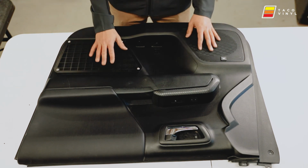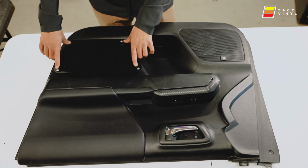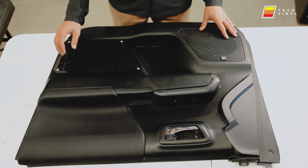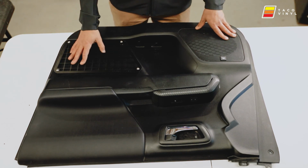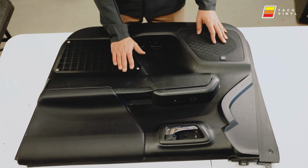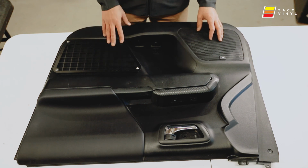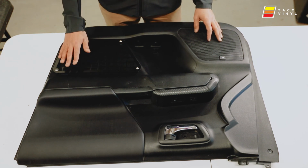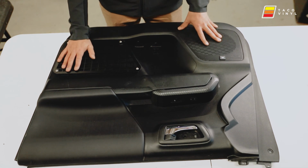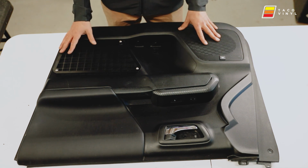Super easy. Then this one, I line it up a half inch from the bottom, then drill the holes and mount the screws. Nothing really has to be removed from the back of this one. And then for install, it's just the reverse. And what's really nice is this is a larger area compared to the 4Runner. So personally, what I'm gonna be using it for is a knife, a flashlight, and either an air up, air down kit, utensils, small tools for repairs, stuff like that. Stuff that's just easily accessible when I'm off-roading and whatnot.